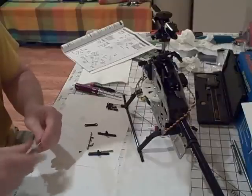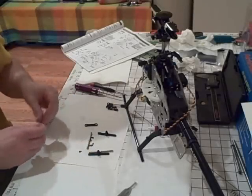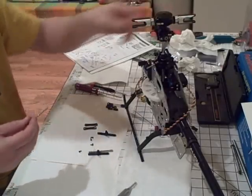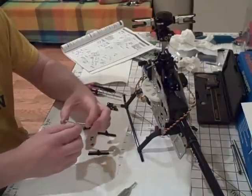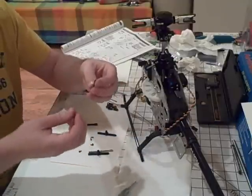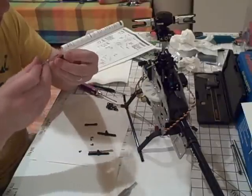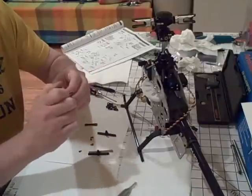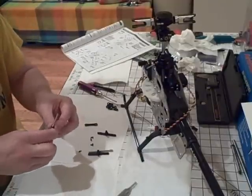This one was pretty tight. Now these are sized. Unlike the 450s where the ball is offset, these are directly centered, so you just need to make sure that you create an opposite — one will be going this way and the other one will be going this way. Go ahead and find the groove, slide the ball on, pop it in, and then check to make sure it's nice and smooth and there's no play.